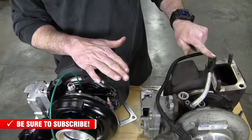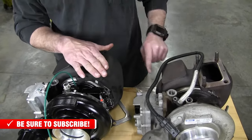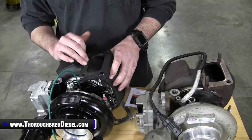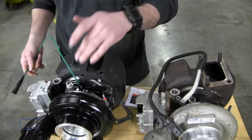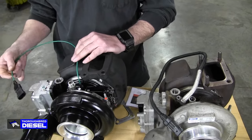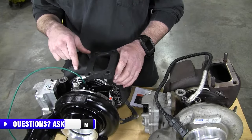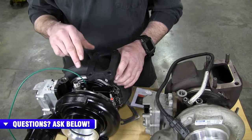The studs — there are three that stay with the turbo, one stays with the manifold. I don't put my new studs in that come in your Fleece kit until I get the turbo in and situated — then I put my studs in. It just makes the installation easier. If you want to be really careful, you could also not put your speed sensor in until you get the turbo in and set. So we're going to finish up the rest of our installation of these parts, tighten everything down, then move over to our oil drain tube.